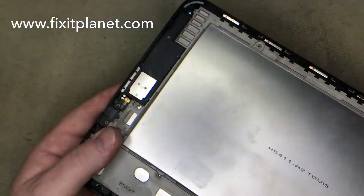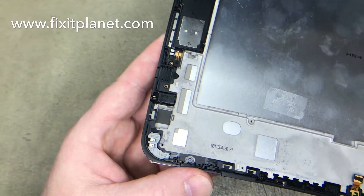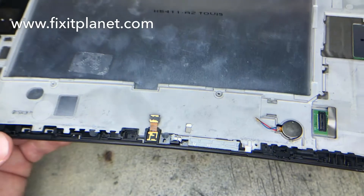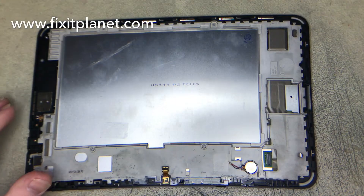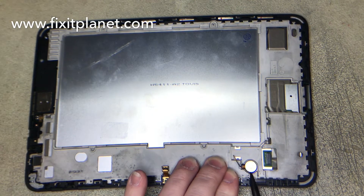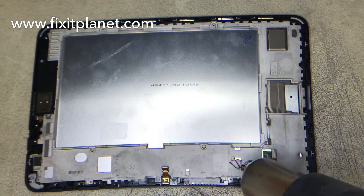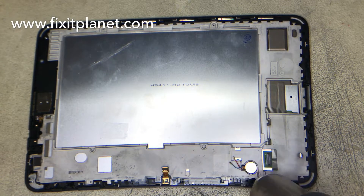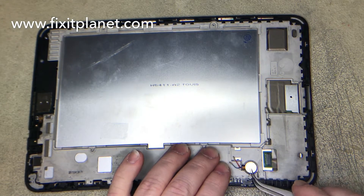And the front-facing camera — it's got that speaker assembly we were pointing out a minute ago, it's got the headphone jack, it's got a vibrator on there. But as you can see, the vibrator is just missing the connector, so we're not going to use that. We're going to take it off and use the original one. It is stuck down with a little bit of adhesive, so you can just warm it up a little bit — makes it easier to take off.